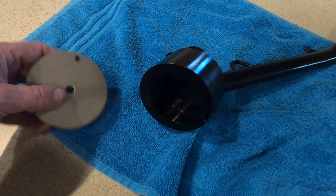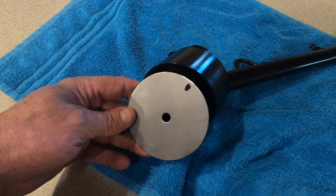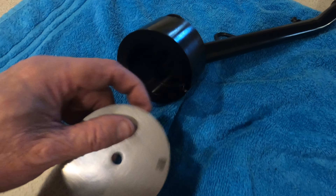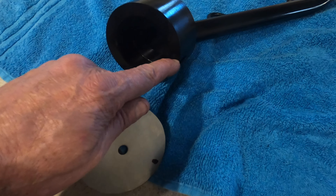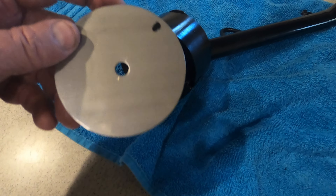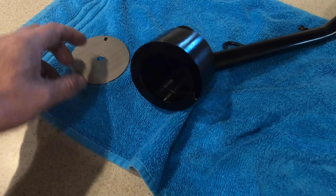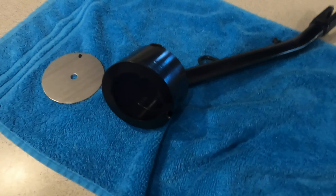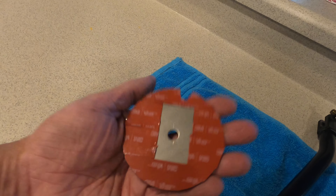So what I'm going to do is use a little thin sheet of stainless steel. I have to notch the stainless steel to accommodate this screw access point here, then I'll get that drilled and notched out and attach it to the bottom using 3M double-stick tape. The notch is in, the double-stick tape is on the back side — all I need to do is peel it off and put it on.